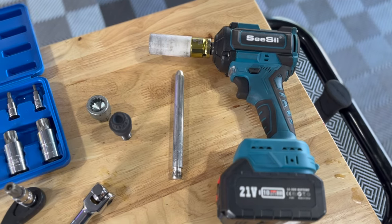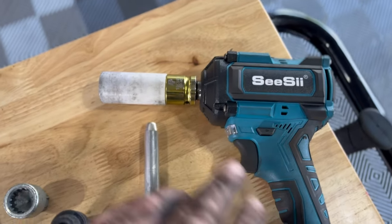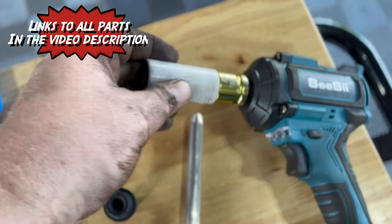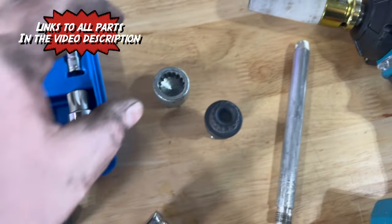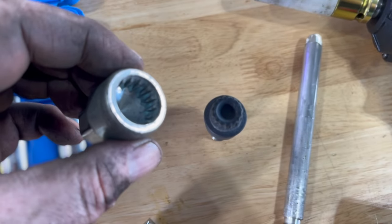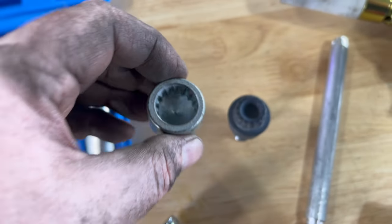All right, let's go over the tools I'm gonna be using today. So I've got myself an impact wrench, and I've got myself one of the synthetic lug nut sockets, which helps you protect your rims. It basically just has like a nylon synthetic cover, so you don't scratch your rims. If you need it, of course, and you've got locking nuts, I've got one locking nut on each rim. You usually find this in your drop-down glove box or with your toolkit. In the Cayenne, it's in the boot. In your 911, it's gonna be in your frunk.